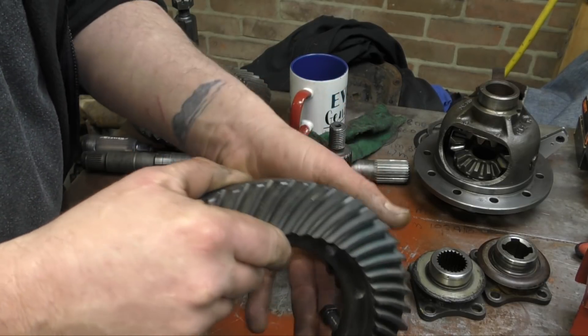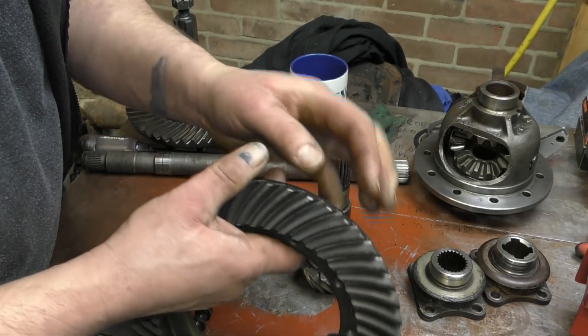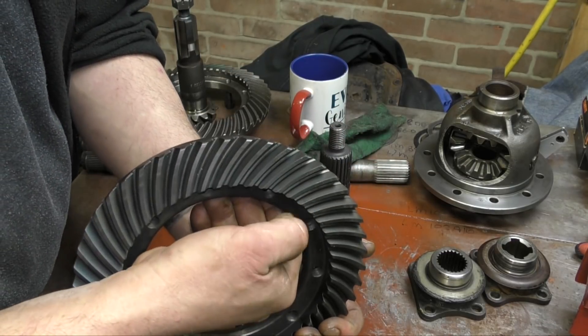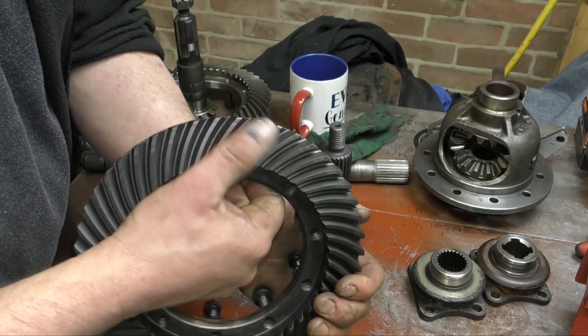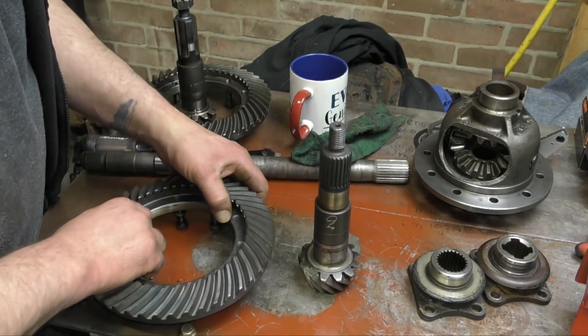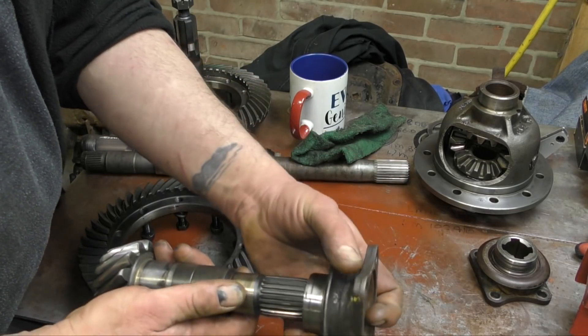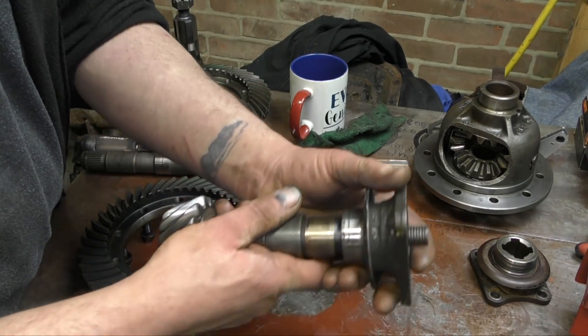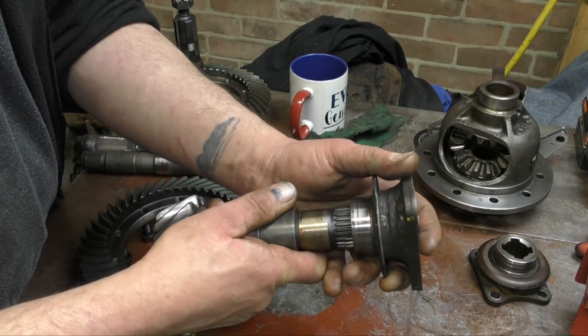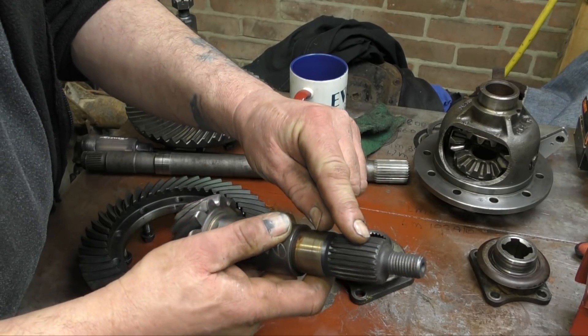I've noticed there's a little bit of damage on this crown wheel, on the tooth, and I'm not sure where it's come from — I think that'll be okay. Basically, what you want to do is check to see your teeth wear and make sure it's not abnormally worn. If it is, it needs to be dumped along with the pinion, because they're matched. On the pinion, where the flange fits on, make sure your splines are okay — they can be damaged, and if they are, that wrecks the pinion.